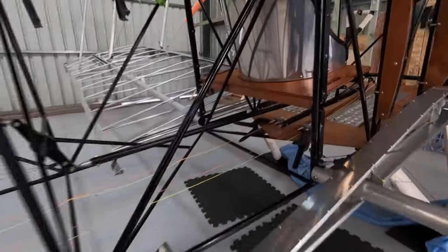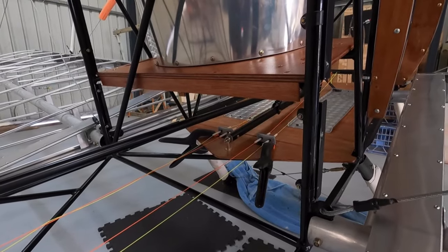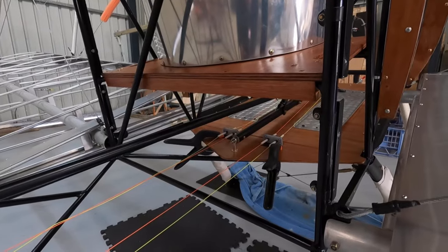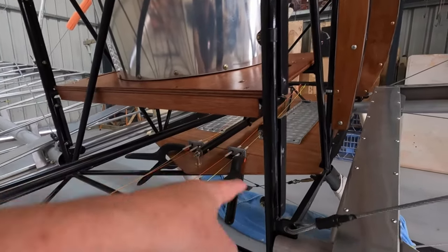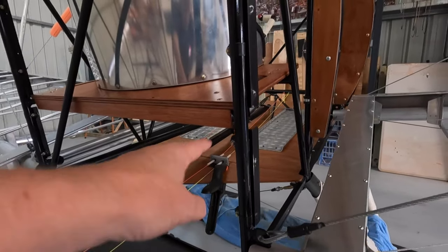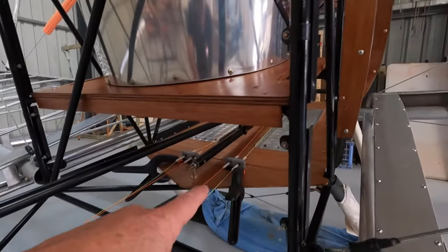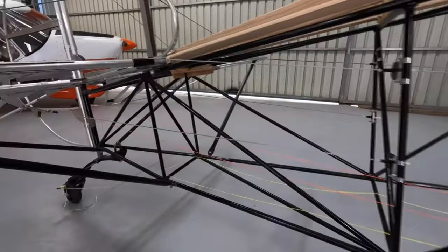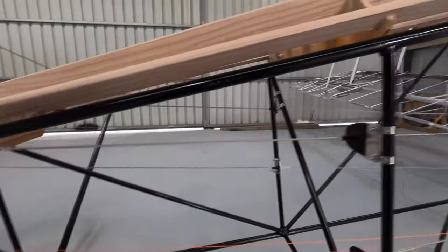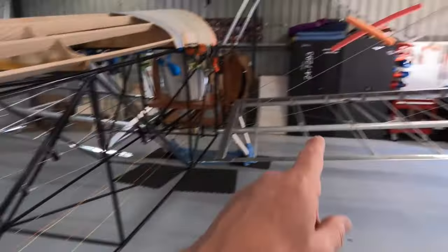I've got the cables set up — represented with string at the moment for the rudder and the tail wheel. There's no guidance on this and it gets very time-consuming and emotional working out how it's going to work. My little blocks up here are going to work well. I've got a bolt to hold the triangle floor piece — you might as well utilize that bolt hole. It positions the cables nice and parallel, so from that fair lead up to the pedals, we're looking good.